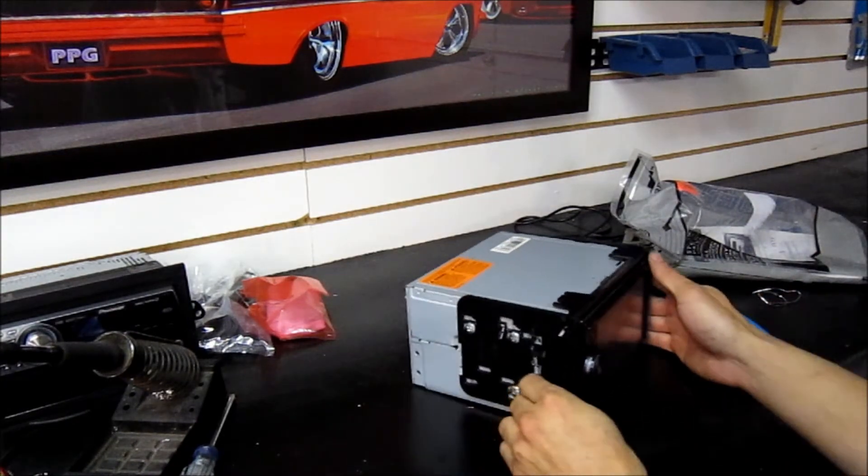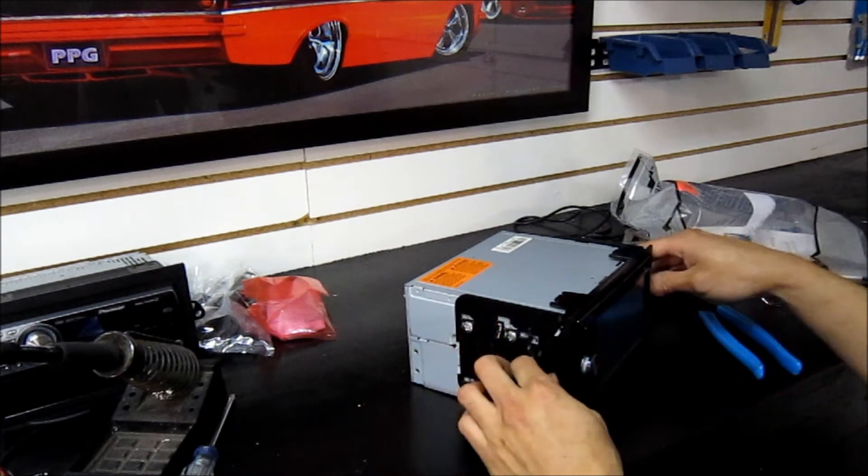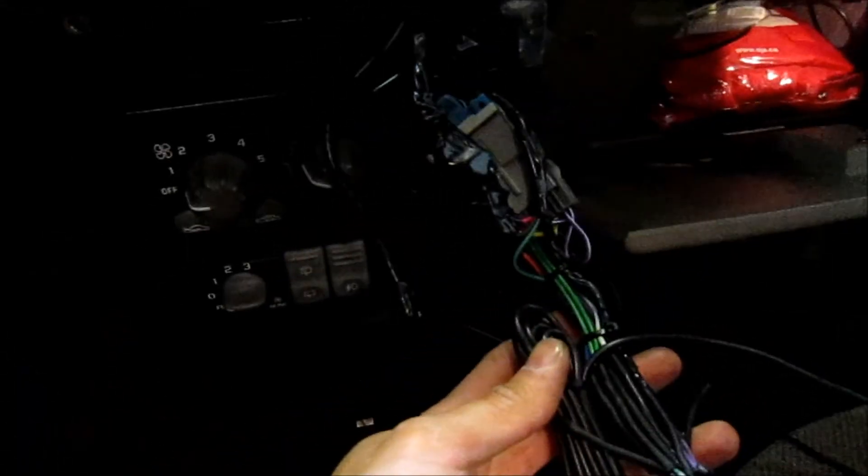The next step is putting on the mounting kit to secure the deck. These are typically multi-vehicle applications so you have to read the instructions and break off the appropriate tabs, leaving only the ones you'll use. We've broken off the tabs and put on the mounting screws so the deck is ready to go in. I've put the Bluetooth mic up in the headliner, running all the way across and down underneath the dash. The harness is plugged in, the steering wheel control module is inside, along with the TR7 and the RAP module. The van has padding down here, which is a nice spot to tuck everything away for easy service access.